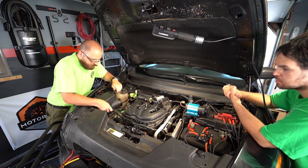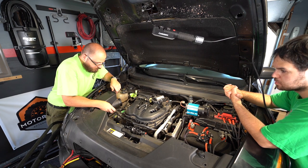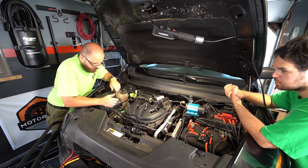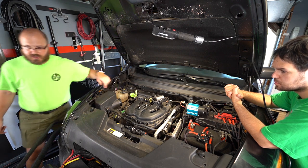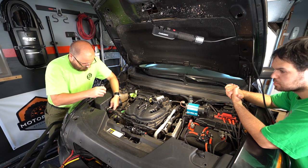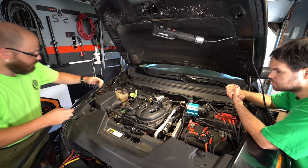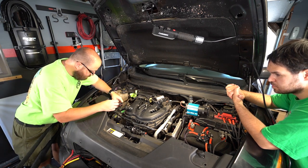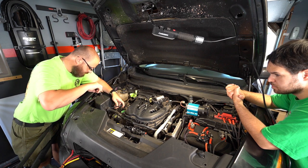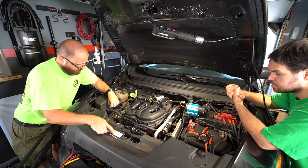We're going to remove this plastic clip. We're going to snip it, and then we're going to provide our extension that comes with the kit. And it's going to attach here, and then go right to the intake on the K&N. So, very straightforward. I'll use some tools to remove this. Just want to be careful, it is a plastic clip, so you don't want to snap it. Oh, remove the retaining piece. That clip's removed.